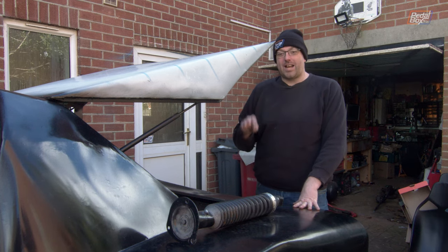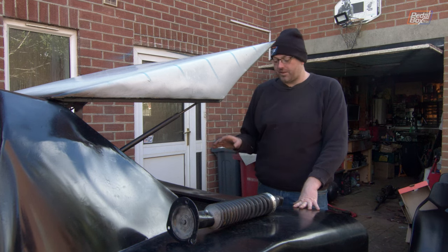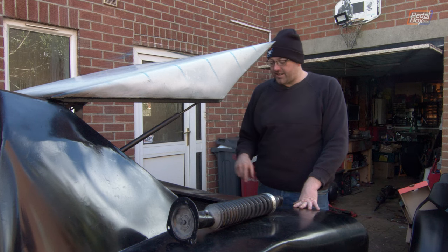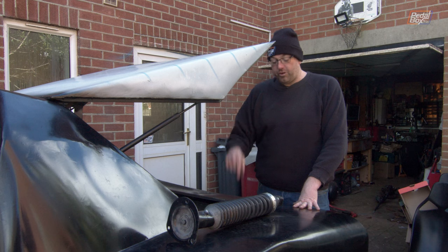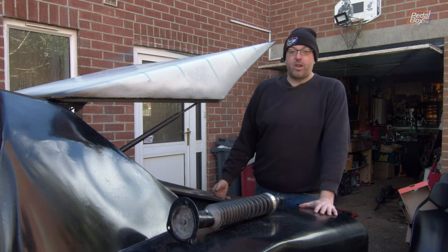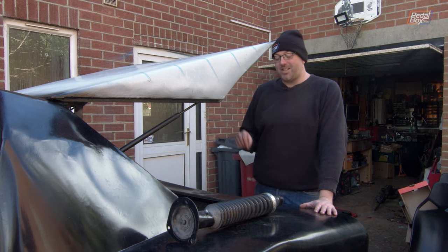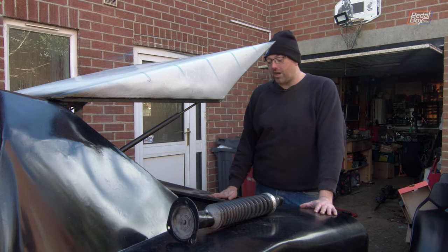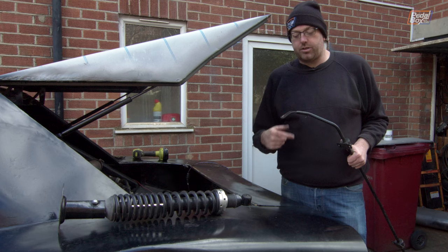That shows exactly how long it's been since we last had the ARB on this car - it's just been sat in the shed for at least 18 months. The easiest way to do this is to take the exhaust out so we can reference from the mounts exactly where the hole needs to go through that aluminium plate, then slide the ARB in from the top. Unfortunately that does mean if we ever want to remove the ARB we're probably going to have to take the exhaust off - we are not as good as Audi at packaging.